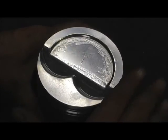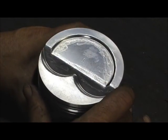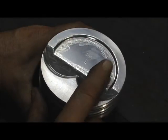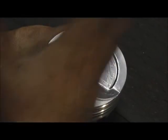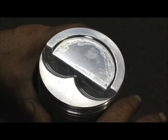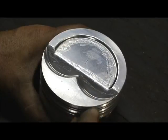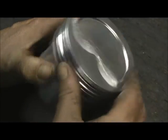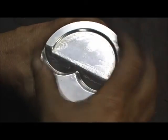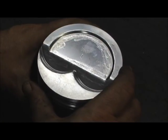Years ago we played with this, and it used to be talked about in the Keith Black book. During the machining process, the pores of the top of the piston are left open. The super high silicon content of this piston — I'm thinking it's 16%, something like that, correct me if I'm wrong — but it's higher than everything else. Keith Black is the only true hyper-eutectic with high silicon content. That's why you have to run such big ring gaps on the top ring because of the heat it's holding, which is an excellent horsepower builder. You get into thermal conductivity and because it's silicon, that's a horsepower advantage.